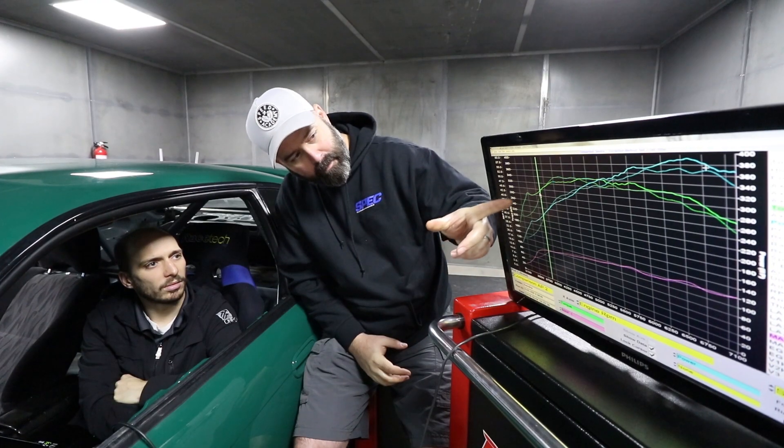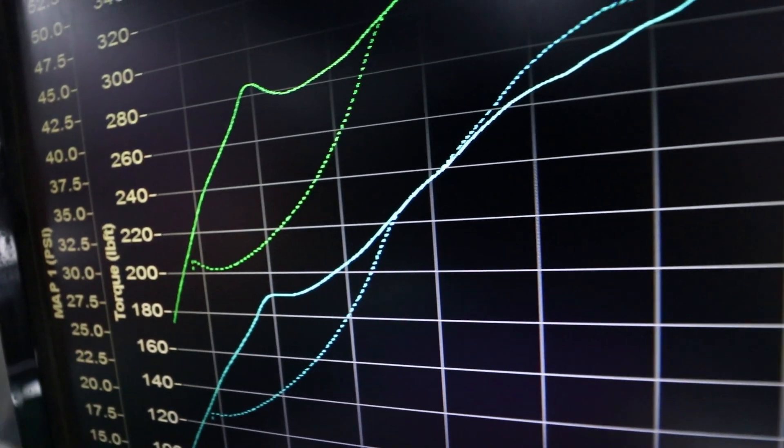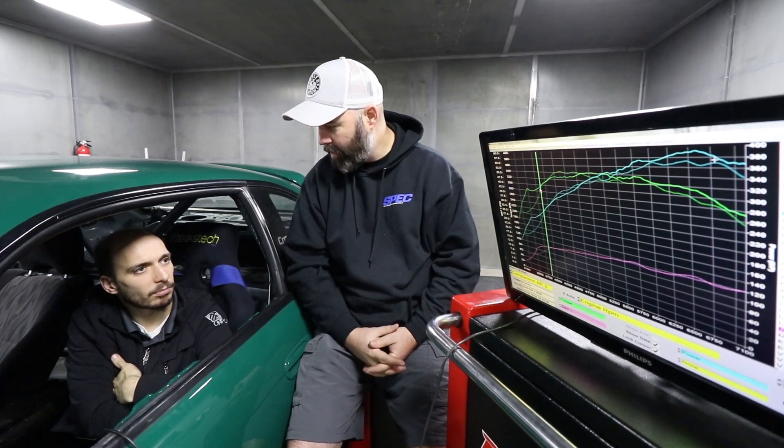Here are the G25 550 results before and after a 60-shot of NOS. The bump visible in the graph is actually the wastegate opening aggressively — not the nitrous hitting. The nitrous shuts off well before that, around 8 PSI. You can see a slight curve change right around 240 pound-feet of torque where the nitrous shuts off, filling in the early part of the torque curve by about 400 to 500 RPM. It didn't do as much as with the bigger turbo because at 3,200 RPM the G25 550 can already make 8 PSI on its own and hit around 200 pound-feet. So there's not as much gap left to fill — they got about 400 RPM more spool from the nitrous.